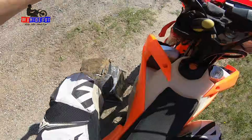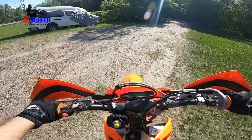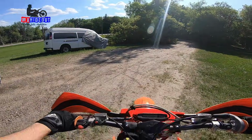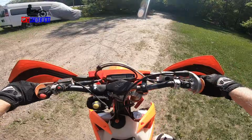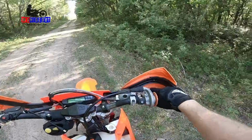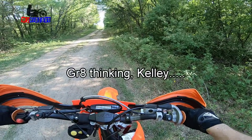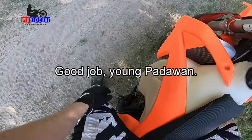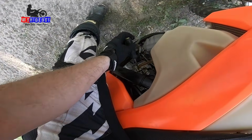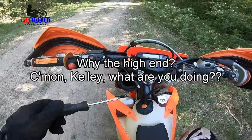So here goes. Oh, I'm gonna turn the gas back on. Ooh. Maybe it needs a minute to warm up. Yeah, it definitely sounds too lean now. Yeah, maybe we need to go the other way, I guess. That's definitely hanging idle, which means it's too lean. So let's go richer on the high end. So half, one full turn.